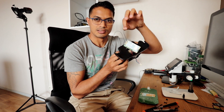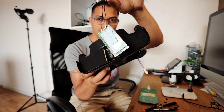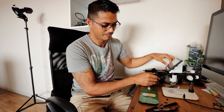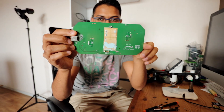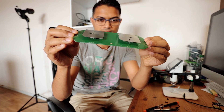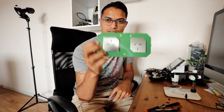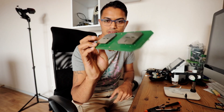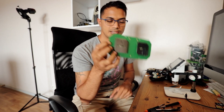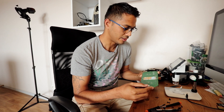The SkyController 2P has a little radio built into a separate unit which has a heat sink, screwed onto the outer PCB. The antennas are different too — the SkyController 2P has these ceramic-coated antennas, whereas the SkyController 2 just has a cheap stainless steel plate as the antennas, and they use the end connectors to connect to the amplifier.